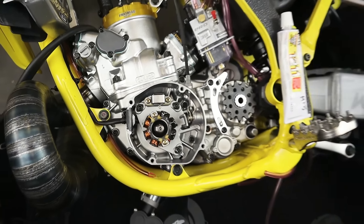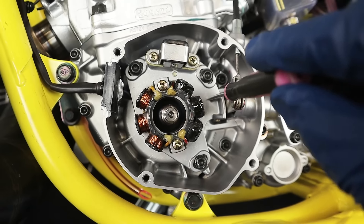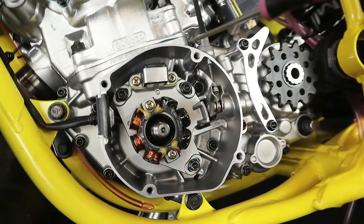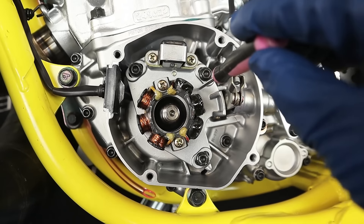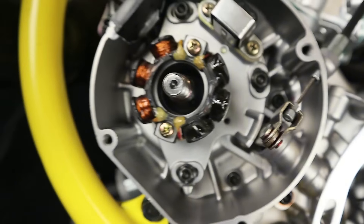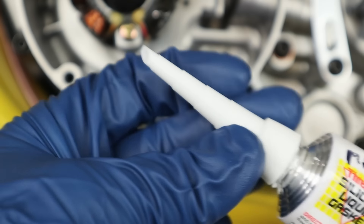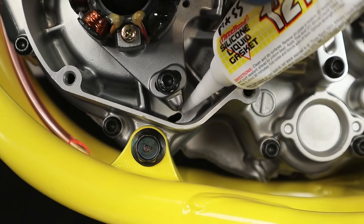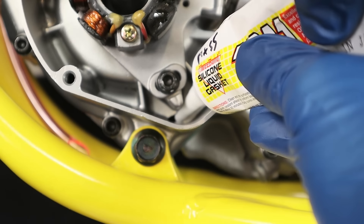On the topic of stators: a lot of those models I mentioned earlier, like the Yamahas, come with an optional higher-output stator that will actually charge the battery. For the RM250 2001 to 2008, you get a battery-only system that is not rechargeable from the stock lower-output stator — so you'll need to keep tabs on it and charge it once in a while. Other models can opt for a charging system, but not the RM250. For an MX guy, I'll just put it on the tender once in a while — not a big deal. Now getting a fresh tube of 1211, let's reach down in here and get some of this stuff shot into that weep hole.